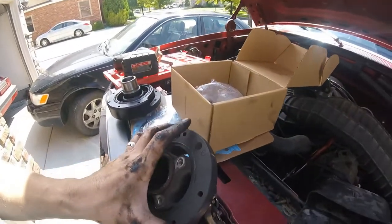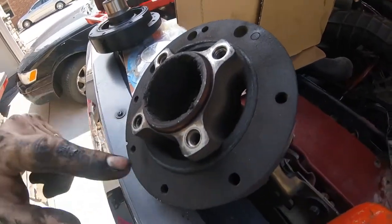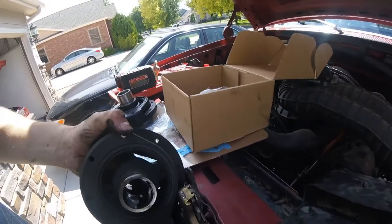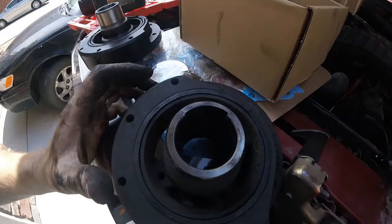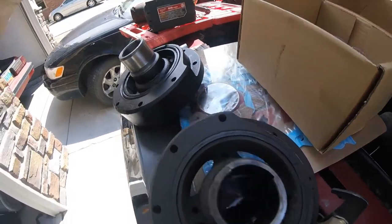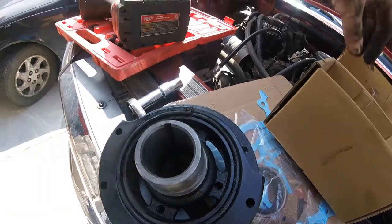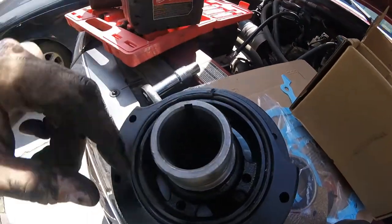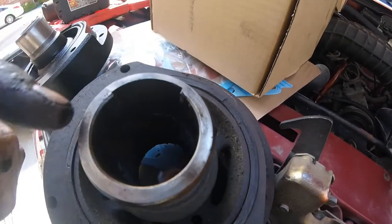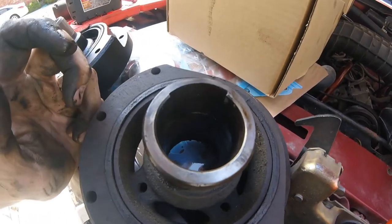Typically the rubber around here — you can see this one starting to crack — this one's probably old, it's bulging a little bit, no big deal. I thought maybe it had spun or was coming off. Can you see that? Your balancer should look like this — there's a keyway notched out for it, and then you've got a Woodruff key that rides in there. Somehow that key wasn't sitting in there right and it just wallered out all the way over. That's crazy — I've never ever in my life seen that.